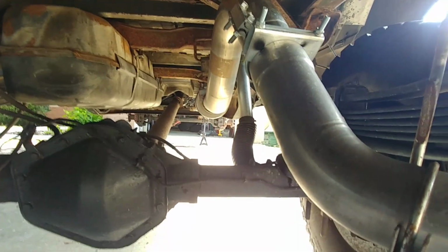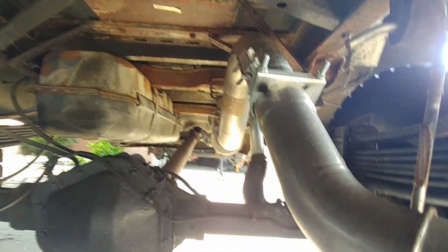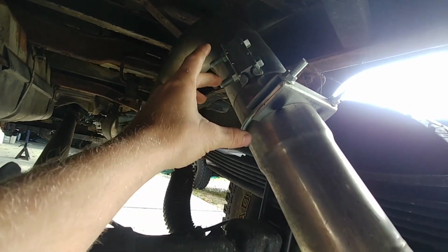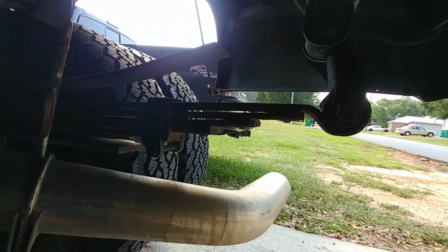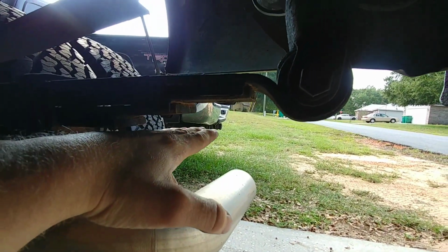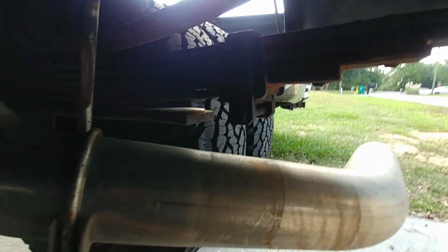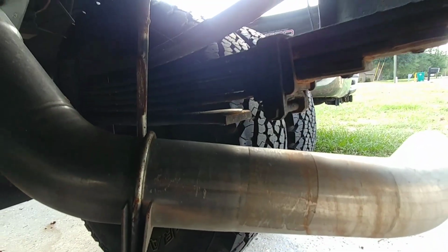Obviously, it was the 4-inch exhaust for the Cummins version, and it bolted right to the turbo, and it's turbo back, and everything fit. The only thing I had to change was I cut one piece of pipe that was about this long off of one of those up there, so I could put the turbo a little bit farther forward and get my axle center line with the actual curve here. And then I had that little bit to add here so that I could clear my shackle flip. If you don't have a shackle flip, this won't be an issue. And you can keep your exhaust higher up and tighter to your body. But because I had a shackle flip, this all came down, so I had to move my exhaust down, because if not, I was going to hit this, and if you flex a little bit, you'll hit it.